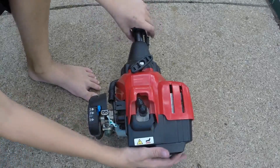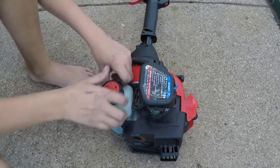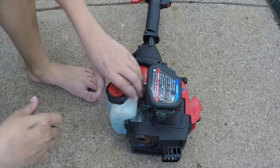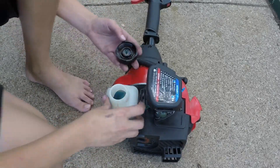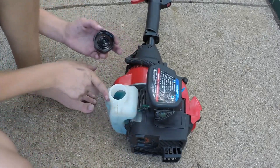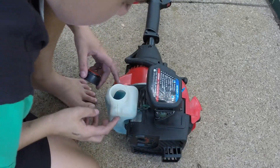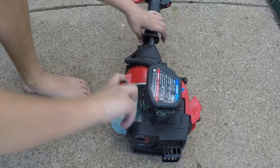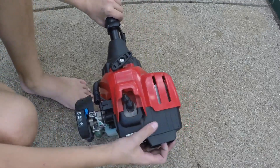The first thing you're going to want to do is flip the edger over and get it so that you can open your fuel tank. Once you open your fuel tank, if there has been fuel in there and you know it's been in there for a long time, it's probably a good idea to take a jar and replace it. This fuel has been there for like a day, so it's good fuel. Inspect it, make sure it's filled all the way up, and also make sure there's no debris in it. After you have checked that, close the cap and make sure it's nice and tight.